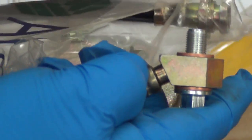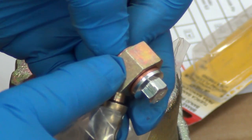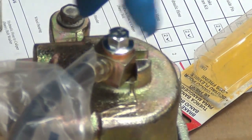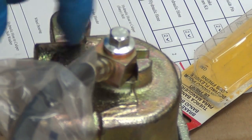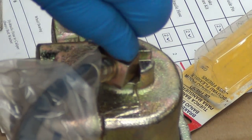This is a hard body bolt. On the 720s, the block is thicker and requires a longer bolt. If you have a 720 hose with a hard body bolt, you only get about that much engagement — I wouldn't be extremely comfortable with that. By the same token, if you put a 720 bolt in with a hard body hose, it may end up going all the way through and hitting the piston before it bottoms out, provided the casting is threaded all the way through. So anyway, that's perfect.